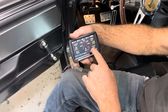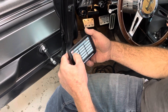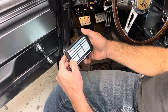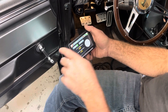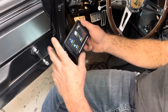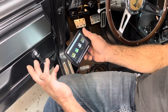Once you plug it in, the screen turns on and you get live data — it tells you everything: RPMs, coolant temperature, and more. Under advanced settings you can go into engine parameters. It shows the 428 engine, idle set at 750, rev limit, and all the safeties. Fuel system injector specs are all dialed in. Fan control is set to turn on at 180°F and off at 175°F. In diagnostics you can check for codes, clear them after repair — basically this is like a laptop for the car.